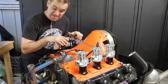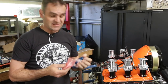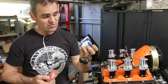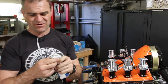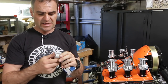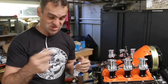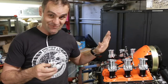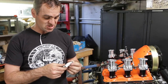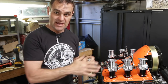It's time to start fitting some injectors and fuel rails. Raceworks have come to the party again — they've sorted me out with some 347cc injectors. They're a common Bosch-style injector used on the supercharged V6 Commodore, I believe. They're good for around 350-400 horsepower and this engine is not going to make that, so I've got plenty of room. I'm just going to use a little bit of WD-40 to lube up the seals and fit the injectors and fuel rails in.